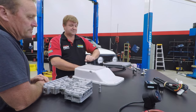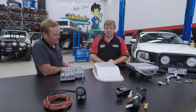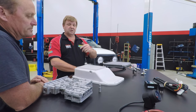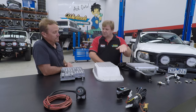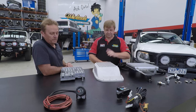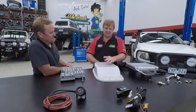Moving on to the lock-up kit — we're probably famous for this, we've been making them for 20 years, starting with the old 80 Series and old GQs. It has two main uses: one is engine braking, which can be used in both high range and low range. If you're towing and coming down a mountain, you can turn the lock-up on and you've got 100% engine braking just like a manual. Coming down the mountain you're not relying on the caravan or trailer's brakes, especially important if you're towing two and a half to three or more tons — on a long downhill those brakes will start to fade, and if it's wet you don't want that. The lock-up allows the brakes to rest all the way down the hill.